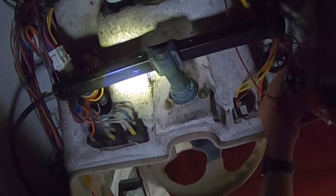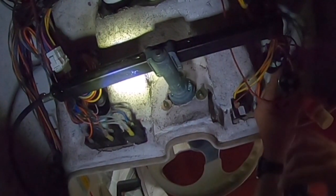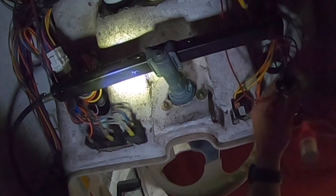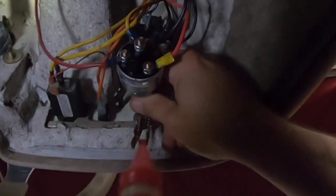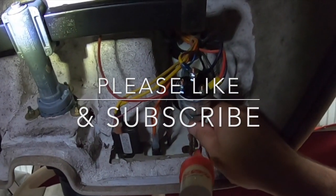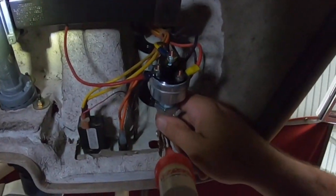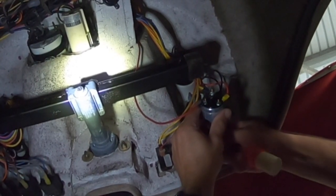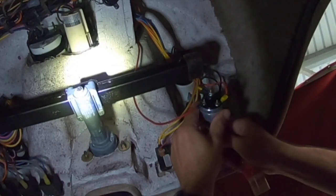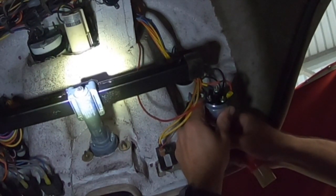The B for battery was down here. There was no M on this one — there was an A. That was the purple wire over here. And the I for ignition is over here. I got it right now and it's running like a champ. I should be able to turn the switch off and the boat goes off. I finally got it in the right order. The key to doing this is labeling your wires and making sure the switch you're taking off has the different letters labeled. Turn it to the on position to crank it — it cranks — then you'll hear the radio come on, meaning it's getting power to the ACC or the A on your switch. Turn it off and it goes off, and you can turn it back to hear just the radio and some of your gauges. So that works.